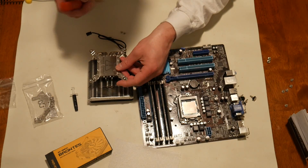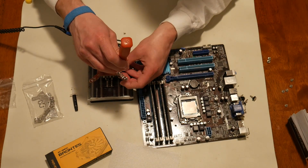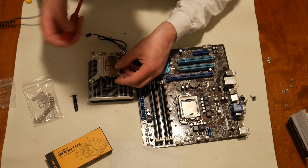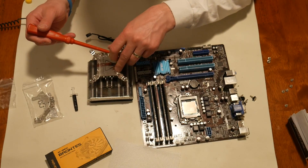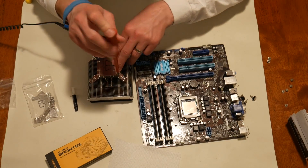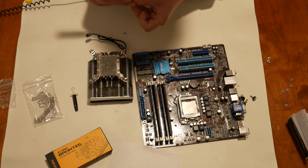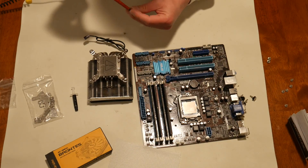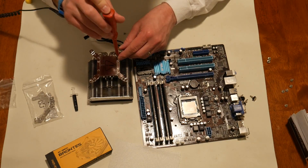Read the instructions that came with it for your CPU type. I think I'm LGA 1155 — LGA 1155 if I remember right. It's been months or years since I've looked or cared. This plastic on this side actually overlaps the screw holes more than the other side, so I do have to slide under there and then peel it back to be able to screw it down.